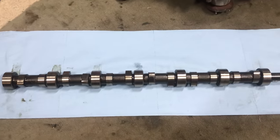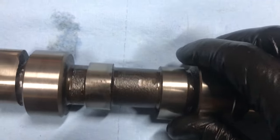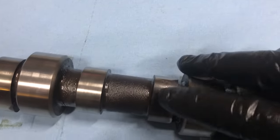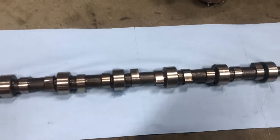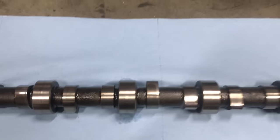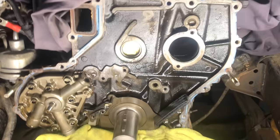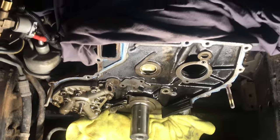That is the cam out of the block. Why did I take it out? There's your issue right there. As those lifters have chewed, they've taken a fair bit off the nose of the cam lobe — and that one too. The rest seem to be in relatively good nick. Those two are the most damaged ones. I've had a quick measure up — it's taken about 0.2 of a mil off. I'm going to talk to the guys at Crow and see what sort of tolerance there is for what they can take off. Sometimes they can machine a bit off the base circle and still have enough on the nose to give you the lift you want. Everything here is ready to be left for the night. I'll measure up the cam bearings in the morning, but at a quick look they don't look too worn at all, which is good.